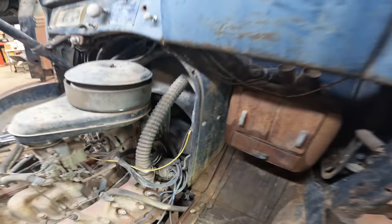And driving a little bit, it runs good. It's just the drive line. It's the first time this thing's moved in forever. I'm the first one to drive it. We literally did not drive it before just now, so I was having a little bit of trouble with the shift linkage hitting the doghouse. Couldn't get it in first gear. Thought it was pulling second gear, wouldn't pull in second gear till I was moving. I had to hold it in first gear.